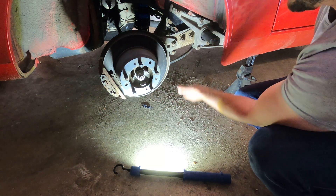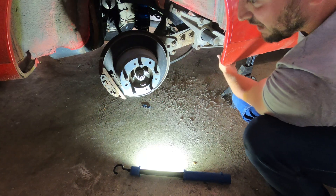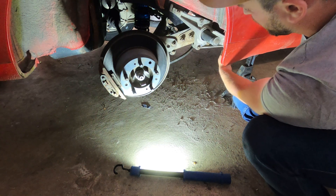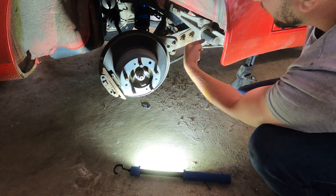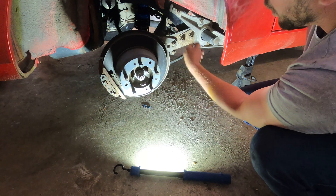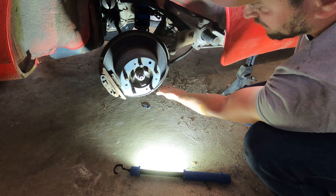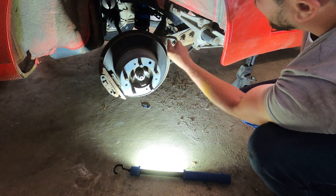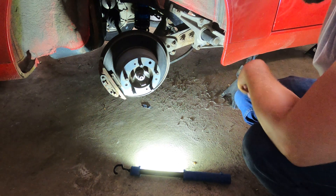From there you do everything in reverse: jack it up, kind of align everything, and go very slowly side to side. If these are off, it was a nightmare getting everything back in. There is a mount that goes this way — one of those 19mm bolts. If you can get that in, you really have to work; I had to use a pry bar a little bit and really angle this up as you go. I used a jack into the support, jacked it into place, then started to jack it at an angle to get everything straight and centered and put that bolt in. Once I got that in, I was able to get the two 17mm bolts for this mount back in.